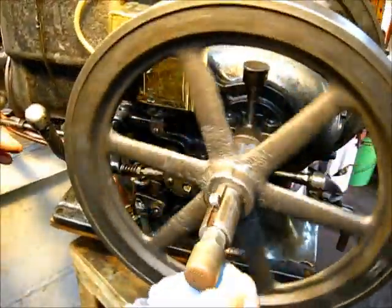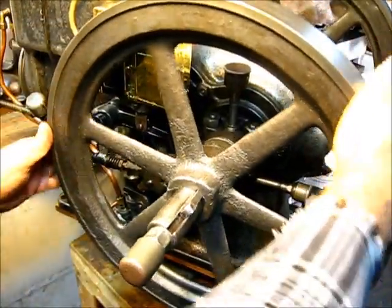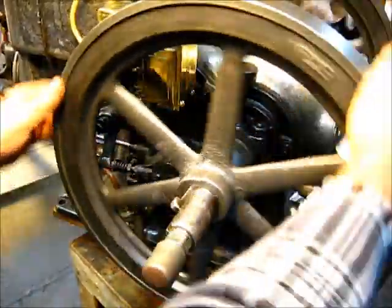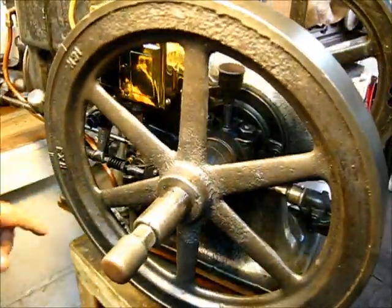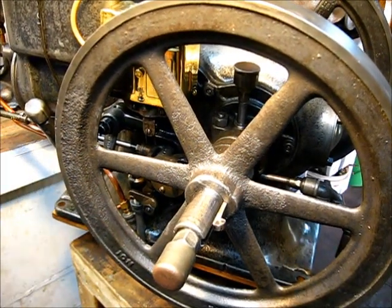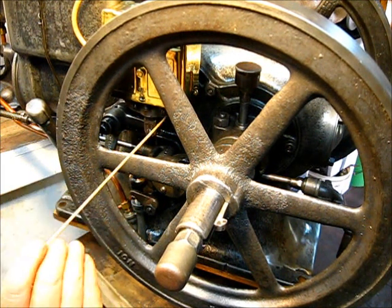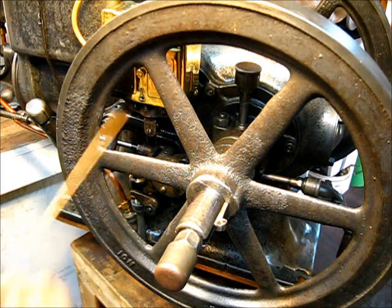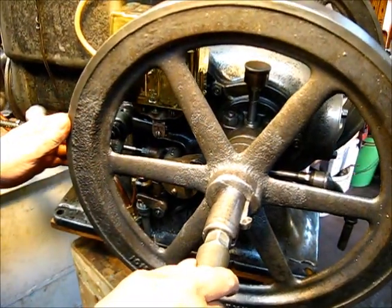I made a few turns right there. Now, see — with just about two turns, we got the spark back. It sparked and it tripped quite well. Now, at this point you need to come around, trip it, and look at the distance right here between that armature and the cores. On this one right here it's a little more than one-eighth of an inch. So that tells me this adjustment here is right.